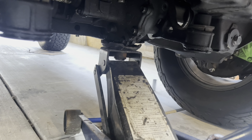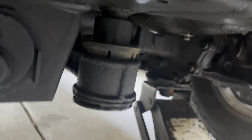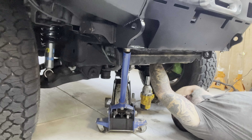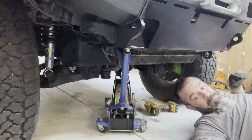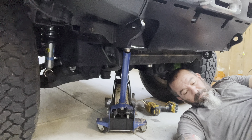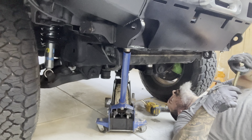Since I'm going full Coastal Off-Road bumpers and skid plates, I just finished up the front here. This is gonna be the front of the skid plate — obviously it's upside down — but I just put the rubber coating on it after paint and primer. Came out really nice. So we're obviously not gonna put the stock one back on. With the diff drop kit, we won't need those spacers because the pan will clear. All we need to worry about today is putting these in — you'll need a 19 millimeter.